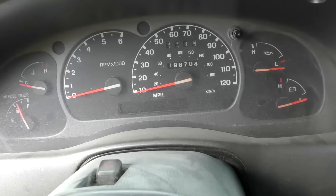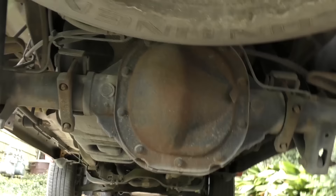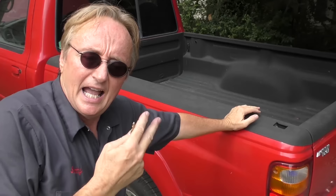It's 17 years old and has 198,000 miles on it. Truth be told on this one, the differential is starting to wear out — it's starting to growl, which is typical when they get that kind of mileage on them. The owner is probably going to just drive it until it drops, though it might still go quite some time before it finally goes out. You could have a full differential rebuild done, which might run you anywhere between $800 and $900.